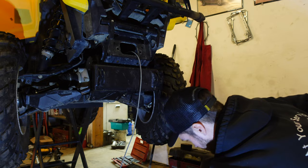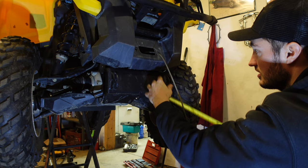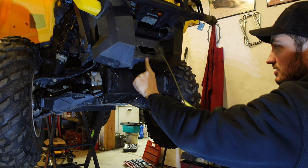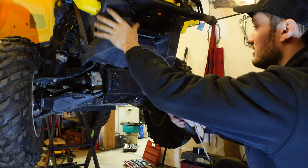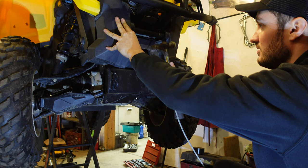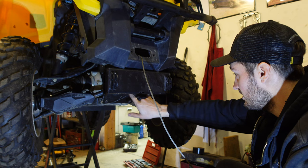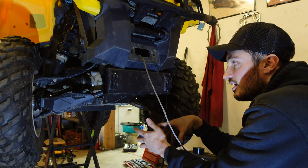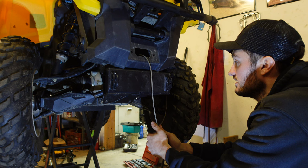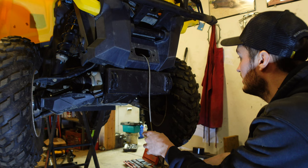I finally think I got the cover where I want it. The old skid plate basically ended up making a nice snug fit. We've got about two and a quarter inches on this curve here — make a nice solid line straight across, nice and level. I actually have to take a little hammer, get a little tappy-tap into place, nice and snug. Once we get the winch fair lead back on there, that'll secure it good. Now we've got to get our bolts tightened up in here and then down below, and that'll finish the install of the plate itself.